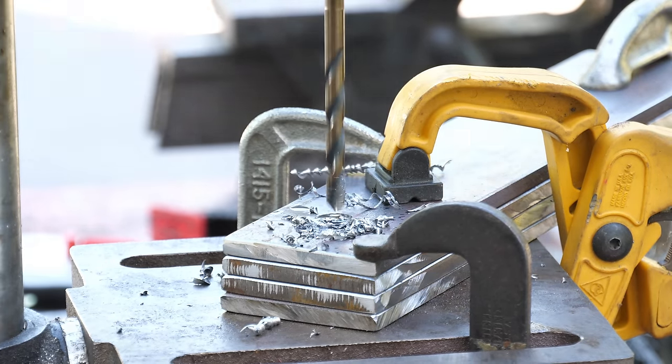To help ensure a good seal at the other end of the pipe, we'll slather that connection with copper RTV and install the band clamp. And while it feels snug, that didn't go without incident. These are the bolts that came with the clamps. These are 7/16 grade 8, and they pulled 2 threads off. Not out of this bar here, so that must be hardened, but off of the bolts themselves. So I just put 3 washers on so that they're grabbing on different threads and they tighten down just fine. Which should be enough to keep everything in place.